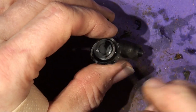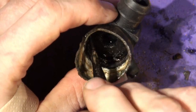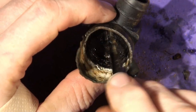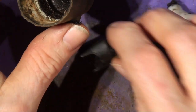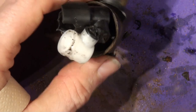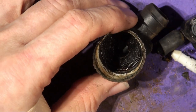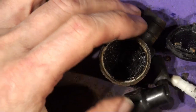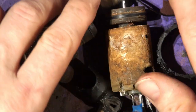Yeah, so it's a way of sealing off the chamber and stopping you sucking air back into the pipe, because it's going the wrong way. Instead of forcing it down, it's pulling it. And then mixing bubbles in with your washer fluid, or just cavitating when enough air comes in. So yeah, crappy seal gone on the old rubber bit, actually on the seal. So there it is. I should put it back together.